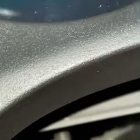Let me show y'all some of these two nuts that hold something in place. Pause, or whatever you guys in that space want to say. They go on the back right here. I can't show you that, but just know these two right here, these are very important. They're like shims. These shims hold the column in place. Well, not in place, but it keeps the column at an angle or whatever, so it's not all the way flush. But you need to make sure you put these back on before you install it back on, or you will have problems with tilt and all that. All right, but that's it, and I'll show you guys the aftermath.